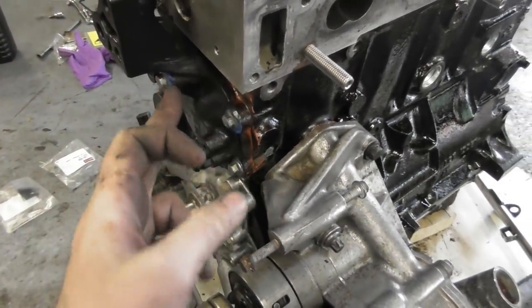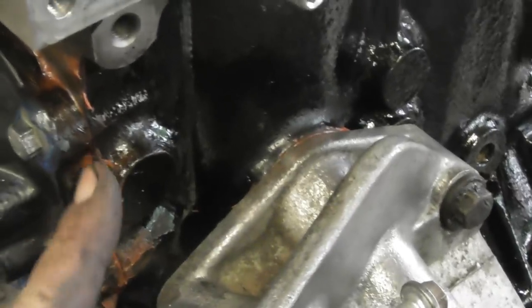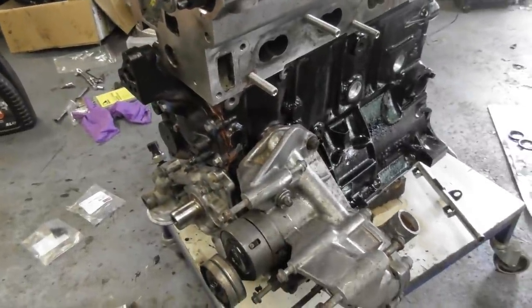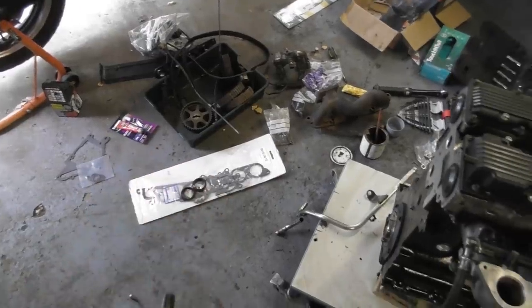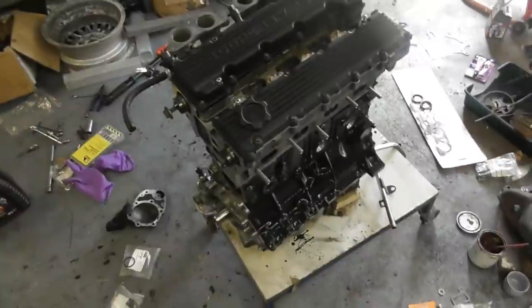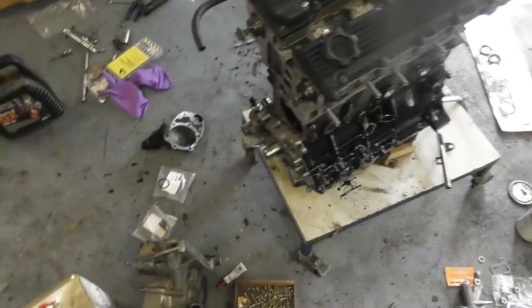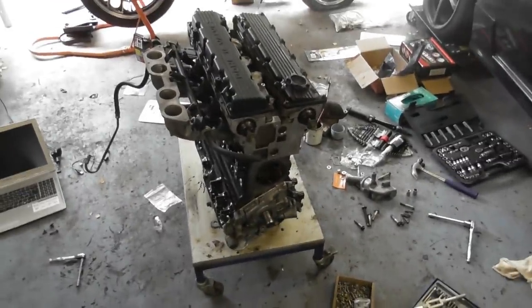That bit there, you can't move easily with your finger unless you put quite a lot of pressure on, and even then it doesn't really come off. Whereas this red stuff I bought — it's only cheap stuff from my local petrol station — it's still incredibly runny after 24 hours. So basically I've lost my confidence in the red stuff. I'm going to take the engine mount and that housing off again, and replace the sealer with my Loctite Black. I've used this stuff on loads of engines — it's really for oil areas, but it works fine on water as well in my experience. So I'm a lot more confident in this, and I'm going to pull that off and do it all again. Quite possibly entirely unnecessary, but the O-ring hasn't been damaged or crushed, so I'm just going to put it all back together with sealer I probably trust a little bit more.